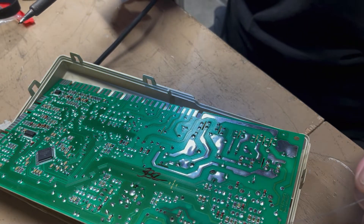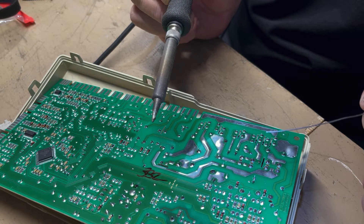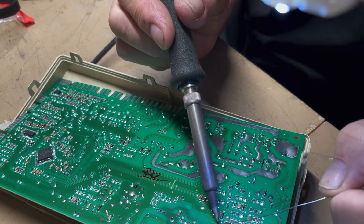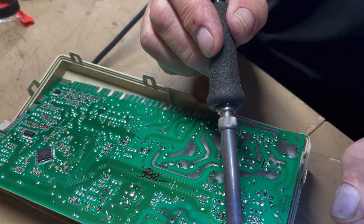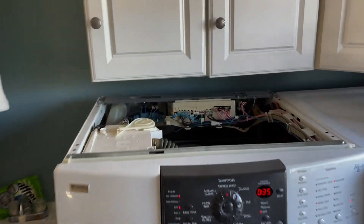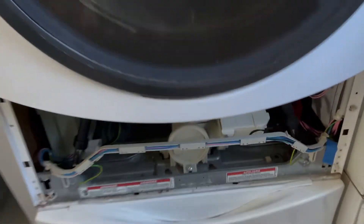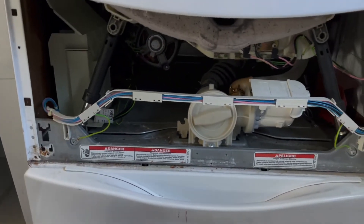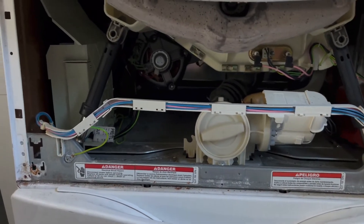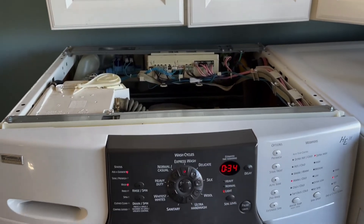We shall see if this washer lives another day. That's pretty much it for the Human Swiss Army Knife, Eric Kirkhoff — remember to subscribe! If you want to test with the lid off, just don't put any water up there, but you have to put tape over this switch down here because it's a safety switch, and you can sit here and watch your washer work. Looks like everything's working. This Swiss Army Knife again kills it.